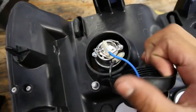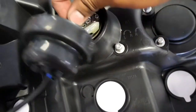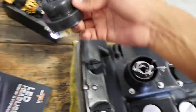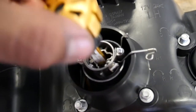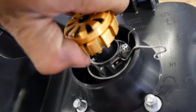So you're just going to take this off first and then just unclip the original headlight and take it off. Then take this off - there we go. Next thing you want to do is take your headlight bulb, the LED, stick it inside and find the place that it sits in. Mine sits right there - once it sits in place you're going to want to turn it.